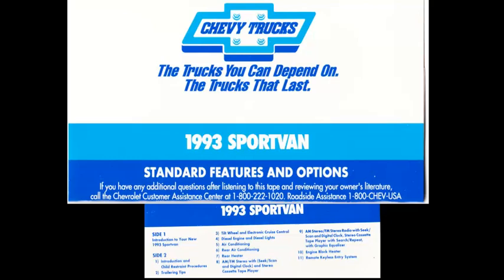When it comes to maintenance of your new Sport Van, different driving situations require different scheduled service intervals. There are two different maintenance schedules depending upon how you drive. Schedule 2 generally applies to highway type driving where the engine is warmed up to normal operating temperatures with minimal stop-and-go driving. Schedule 1 is applicable when your vehicle is used for short trips, towing a trailer, driving in cold or dusty situations, and frequent stop-and-go driving. Be sure to read the maintenance schedule in section 7 of the owner's manual to select the correct maintenance intervals and procedures for your driving conditions.